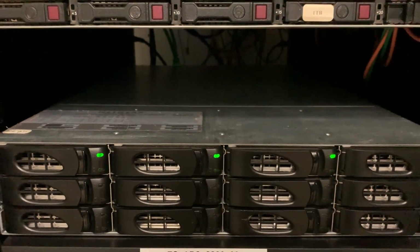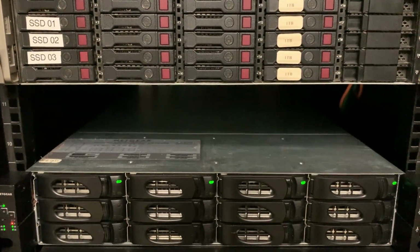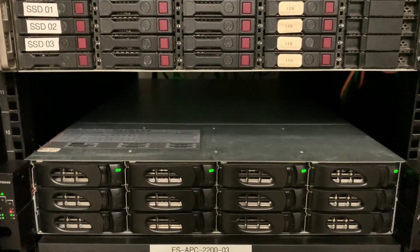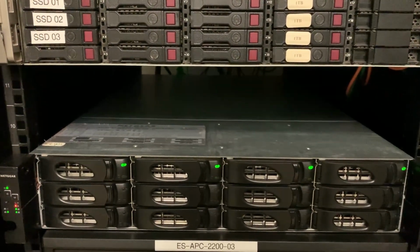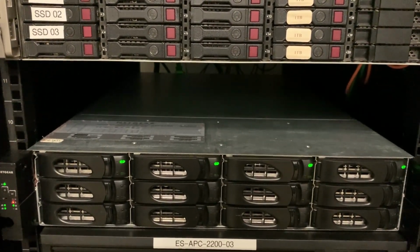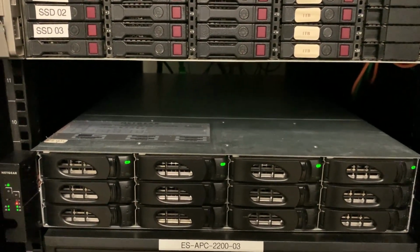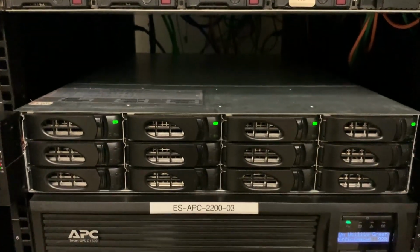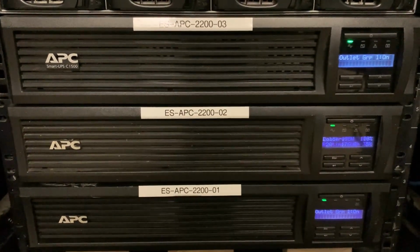We also have a NETGEAR ReadyNAS 3230 that will be running as our NAS and backups, and maybe NFS/iSCSI server. Current specs are 1 Intel i3-3220 v2 at 3.30 GHz, 2 cores, 4 threads, 4 gigs of DDR3 ECC memory running at 1333 MHz, 2 10 gigabit network ports, 4 1 gig network ports. The server does have 4 8 terabyte drives, which are Western Digital Red Pro drives in a RAID 5 configuration.